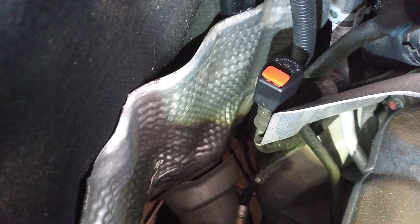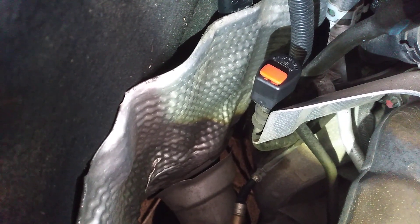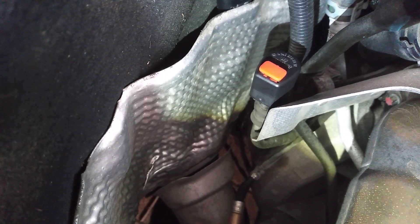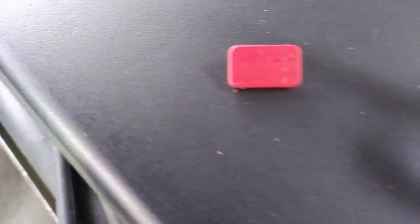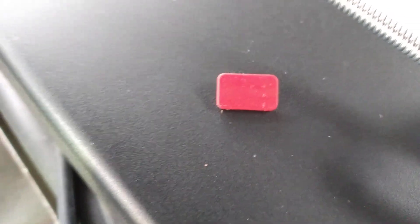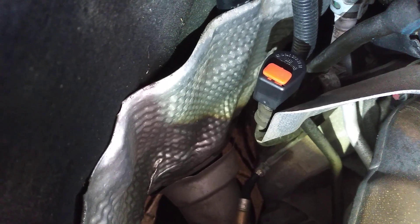You're going to have to sacrifice that little red tab to lift the black cap off to be able to dip your level of your transmission. This is what you end up with - it just snaps off with a little bladed screwdriver. The piece which attaches to the bottom goes downwards into the cap; you just press that down gently, and that'll allow you to take the cap off.